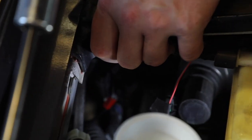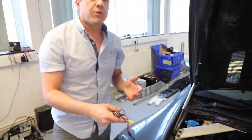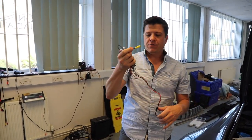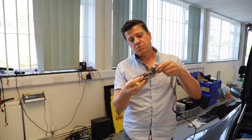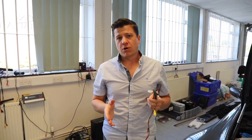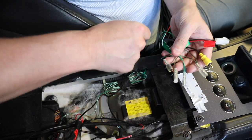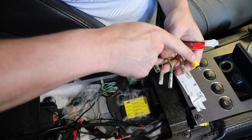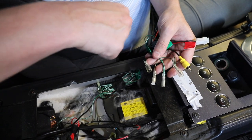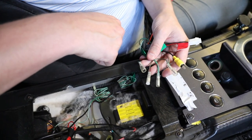This is where that camera lead plugs in and we're going to be running the wire up through here. It's going to go down and drop into a hole, which you need to punch through the grommet that goes through the firewall right there. On the other end of that is all of this. This is the wire that's going to be going through the grommet — and eventually you're going to have this bit of more wires — under the armrest in the car. Here we have the harness that we started off with at the front camera. We have the video input that's going to go to the rear of the car, and an extension is provided as part of this kit, which will be run along the car along with that central loom that we installed at the very beginning.